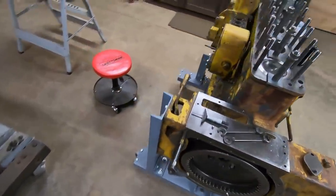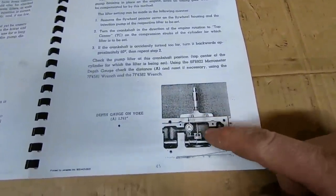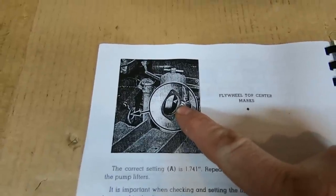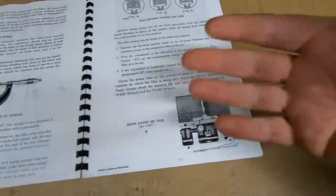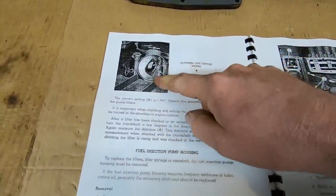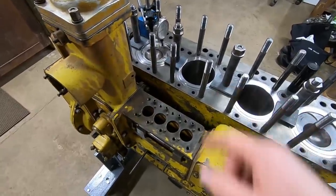Welcome back to the channel. Now that we have the flywheel on the engine, we can set the injection pump lifter timing. It's a pretty straightforward process. You take a depth gauge on top of the pump, measure down to the lifter yoke, and when your pointer and flywheel timing marks register to the proper compression stroke of the proper cylinder, you want to see 1.741 inches down from the top of that pump into that lifter yoke. That measurement of 1.741 inches at top dead center will put your injection timing at 24 degrees before top dead center — that's when the injection event will begin, ensuring proper engine performance, fuel delivery, and timing.